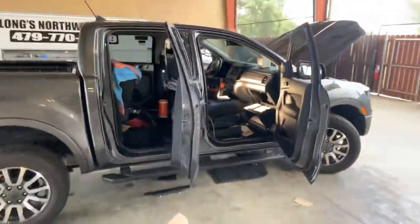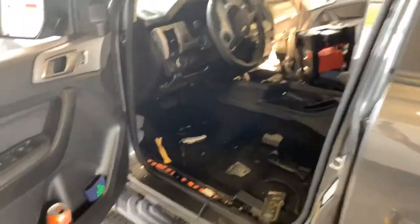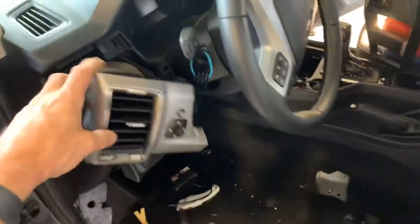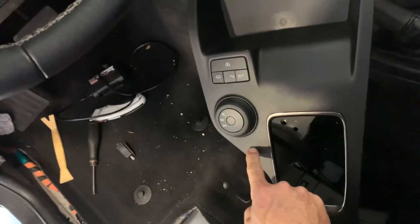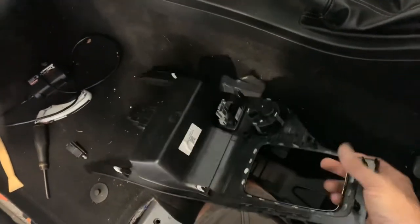So that being said, if you have a Ford Ranger that does not have blunt-cut wires or factory-provided wiring for your brake controller, you will have to do a hardwire installation. That will vary depending on what product you get. We're doing the TPE by Redarc today, and it does require a little more finesse to make it look nice, neat, and pretty. I've taken some of these panels apart to find a good place to put the remote control knob, and we've settled on this panel right here next to the shifter. Your brake control activation unit will be about the size of my thumbnail, located right here — that's the only part of the brake controller you'll see. That's what's so cool about the TPE, but it does require more panel removal and installation time.